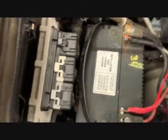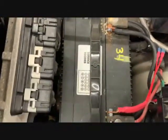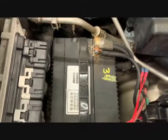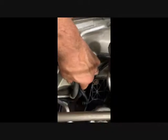Something else I noticed earlier and forgot to mention: the battery's not being held down by anything, it's just sitting in there. Typical used car dealer can't even put a battery hold-down in there. So in addition to the braided covering, I also put a piece of loom to protect it when I secure it underneath. That piece of loom comes all the way up under the hood to here. This will be secured in this hole — I have loom clamps, I can put one in the hole and clamp this in place. I'm going to secure it underneath, probably to the top of that half-ton clevis with those two tabs sticking up — that'd be a perfect spot.